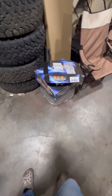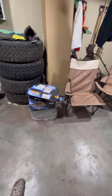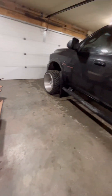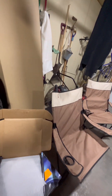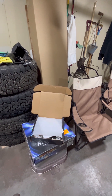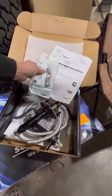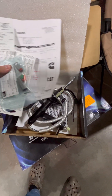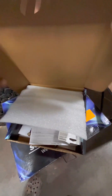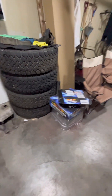Got another shipment — a Southland SDD3250-GX clutch. That is the half organic, half ceramic. I read really good things. Part of the reason is it can hold more power — it's rated for 650 horsepower and 1,300 foot-pounds of torque. That's kind of where I'm going to end up, or would like to end up for now, and see how it goes. It comes with the hydros — new master, new slave. It's already pre-bled from Southland with the reservoir. What an awesome setup to install. Messing around bleeding masters for clutches and slaves — I would spend double just to have one that's pre-bled, 100%. I'm super stoked on that.